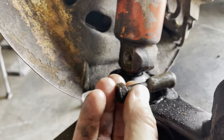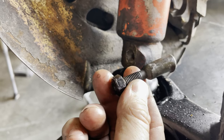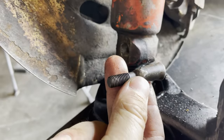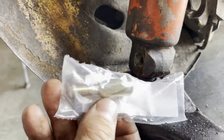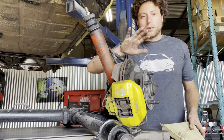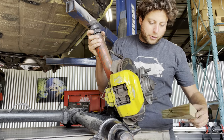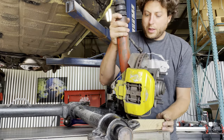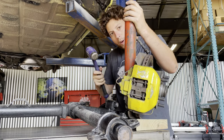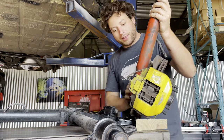I just removed this pin here — it's just a wedge pin. Remove the nut first, then whack it with a hammer and it should come right out the back. I didn't mind messing up the threads because we sell brand new ones — pretty cheap, definitely worth getting replacements. To remove the spindle from the front control arm, wedge a 2x4 under the brake rotor, lift up so the control arm comes off the ground, then give it a whack with a hammer and it should pop right out — just like that.